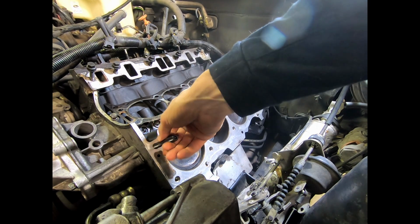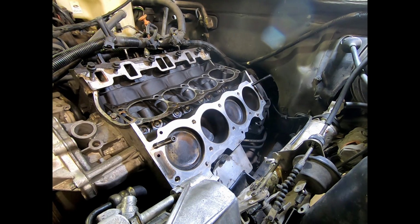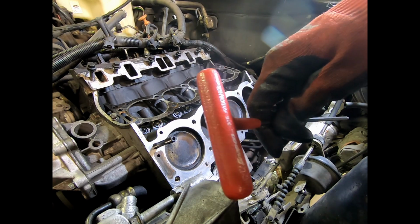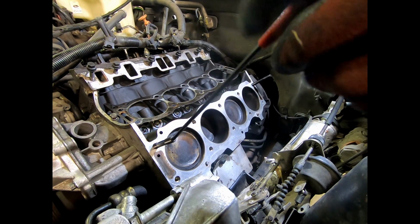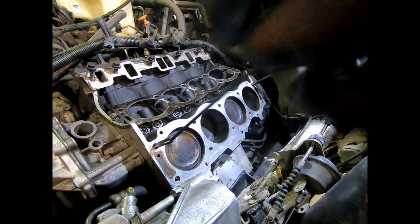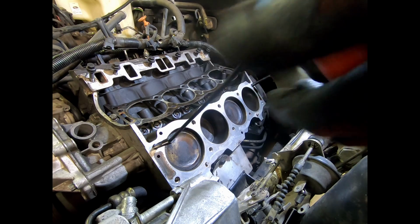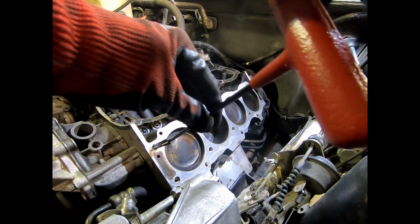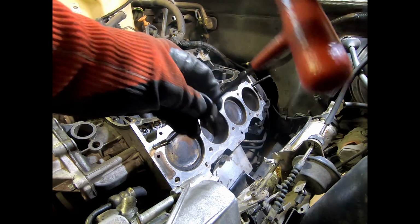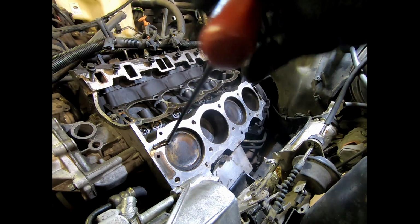If you put it in and that is missing, you've really screwed up because you put the wrong thread pitch in. To make things a little bit easier, I have a 3/16 T-handle driver, and the instructions are adamant. Do not use any kind of torque. Thread them in finger tight. So that's another thing to beware of. I basically get them seated and do a 32nd of a turn maybe after I feel it going.